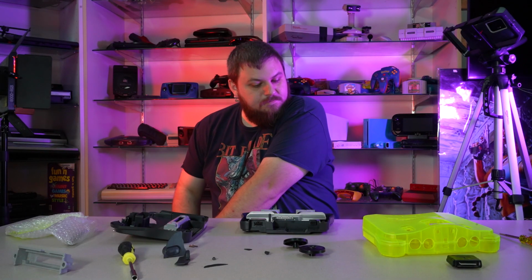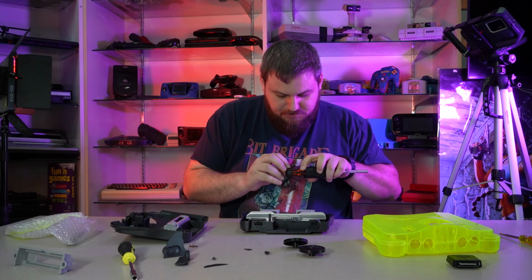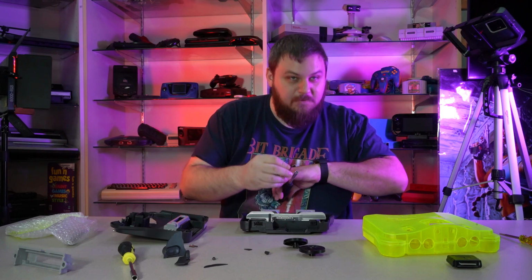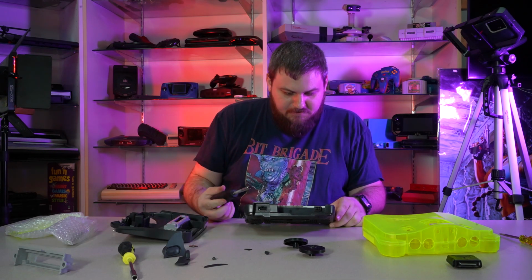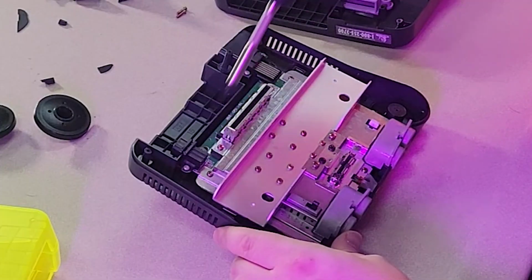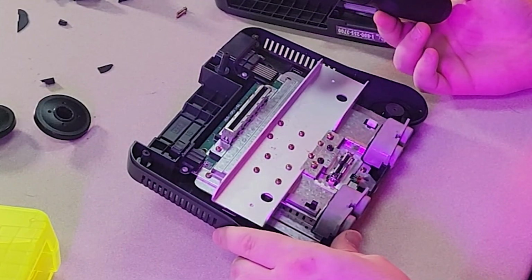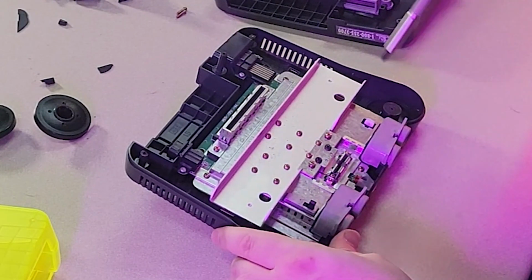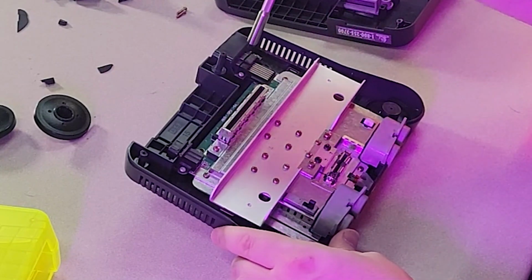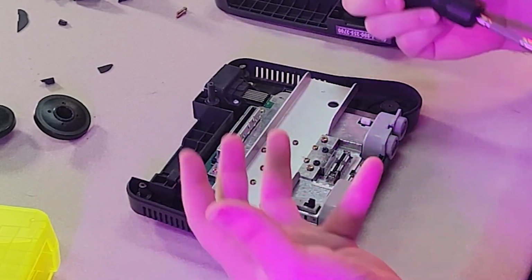Once inside, it's all just Phillips heads. So you can take your favorite driver of choice. Lightest tech tip screwdriver. Is that what this is? Yeah. Not sponsored. And then let me see, because I did that other one a few weeks ago now at this point, so I'm trying to remember. The one thing I did remember is I took all of the ones that look like they'd be the ones you take out, and then it was still held in, and I couldn't figure out what was holding it in still. So I took all of these out. That's something you don't need to do at all. You get the ones out on the side and the ones holding in these back ports here, and then it's the 2 screws next to where the jumper pack would go. You take those out, and then the whole thing comes out.